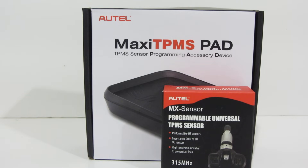I have a 2009 Honda Odyssey EXL. It can only remember four sensors at a time, so if I put a new one in, it won't be able to recognize it. I'd have to go to the dealership, get them to plug into the computer and teach it the code for the new sensor that I put in.